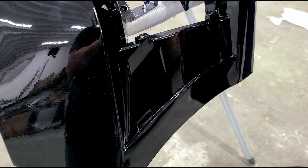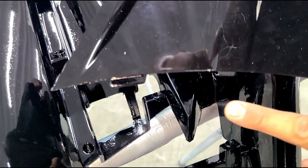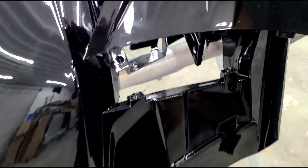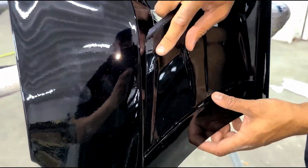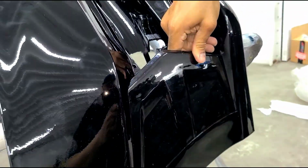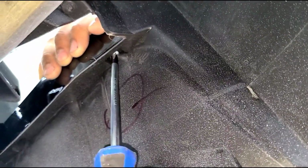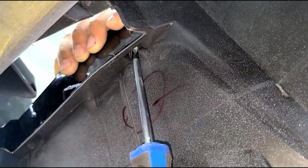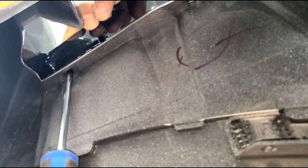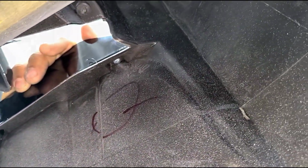So we're gonna install the side trim pieces. There's some little slats that are here, which matches also the trim. As you see, there's like 3. You're gonna have to kind of tuck in and then push in. It's a little bit hard to get on the video. And then you screw it on the back with 2 small screws. The screw is tucked in through the little grooves as you guys see there. It's a little bit hard because I'm filming from the bottom. Here's the second one, and you'll do the same on the opposite side as well.